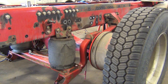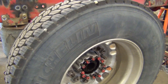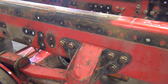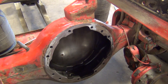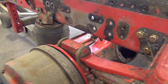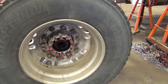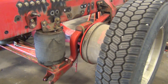The primary axle has been put in the mid position plus six inches, so this is a 236-inch wheelbase. Because we're doing the rear end ratio replacement on this truck, George and Carol are going to be putting on a lot of miles. It really made financial sense — the return on investment to change out that rear end ratio made sense in just a few years. The 2.67 rear end ratio is going to give us great fuel economy and it'll pay back in short order.